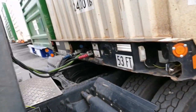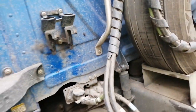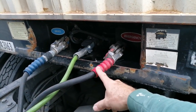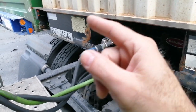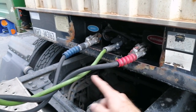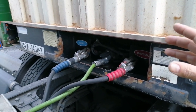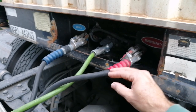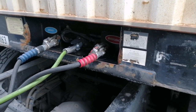Let me walk you back here and show you something. These lines come off the tractor. This line here is the emergency brake line for your trailer. The blue line is the service line coming out of the tractor — so when you slow down your tractor, the blue line slows down your trailer. The red line, if it pops off, will lock the emergency brake. If you're on the highway and this line comes off or breaks off, it'll automatically lock your brakes.